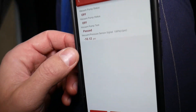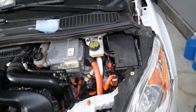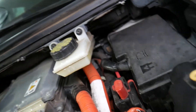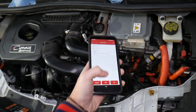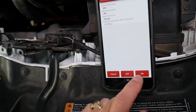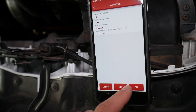The vacuum pressure is currently reading negative 10 psi. Let me come outside now — the pump is located by the booster, all the way in the back. You can see where it's located near where the brake lines are going, directly behind the dash. When I turn it on, listen — you can hear it working. That's the vacuum pump right there. The pressure will go down, and if you don't have vacuum leaks that pressure should stay at around that same number until you let it sit for a while.